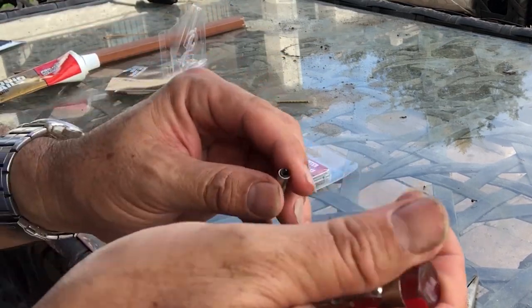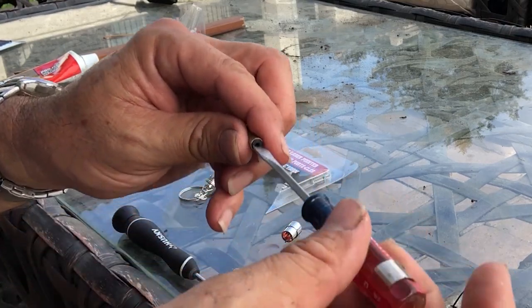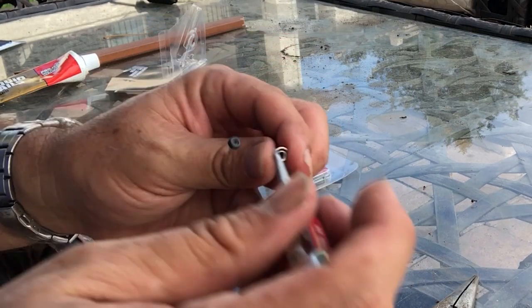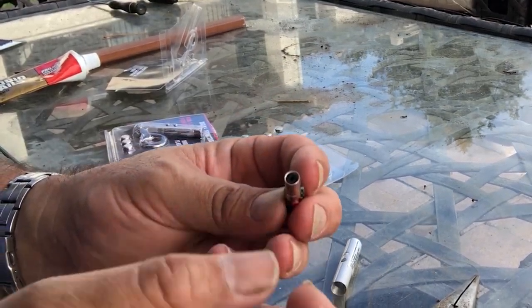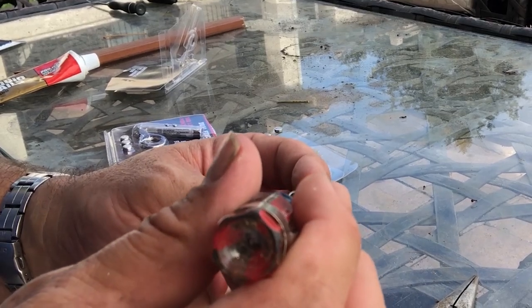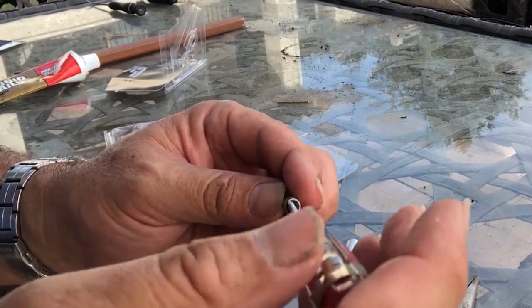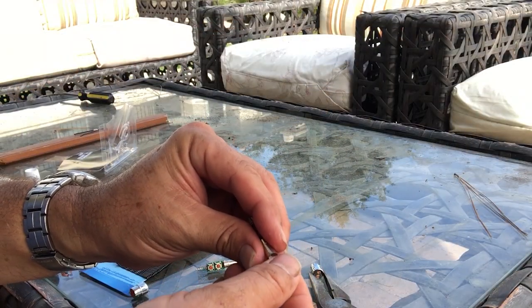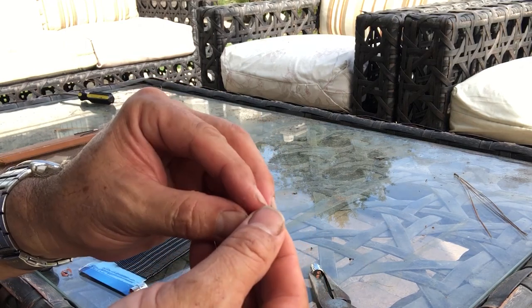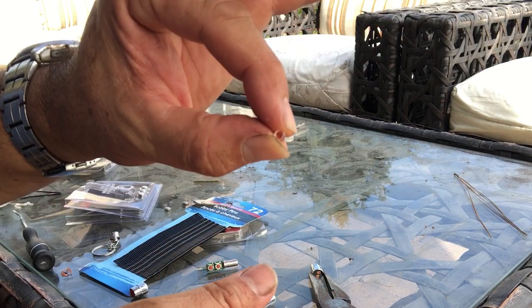But you may end up scratching the lens, so be extremely careful. Be careful unscrewing this because the whole apparatus inside is spring loaded. If you're not careful it'll shoot out, so make sure you block it with your fingers. If you take a look you'll see grooves for a flat head screwdriver — you just need a small one. Right underneath the thing you screw out is the lens. Once you remove this o-ring, you'll find the lens right underneath it. And there you have it.